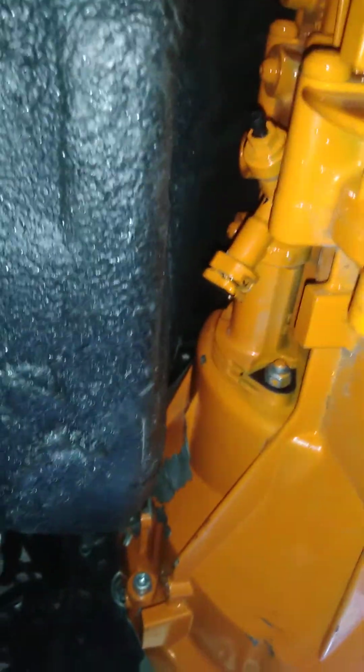The problem was I get the box all in place and it's really tight, mega tight. There's not much room for fingers, and especially when the box is back, getting it up there is hard. Getting it to mate up to the engine, I get it quite close and it'd stop, and I couldn't figure out what it was. So after much shifting around, I shifted the flex plate back on a thinner shim, moved the starter motor back. It was close but still no dice.